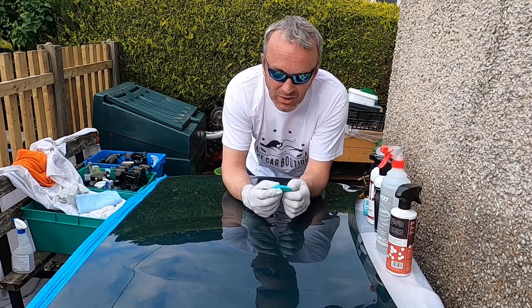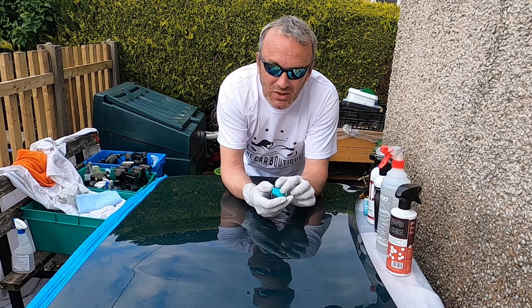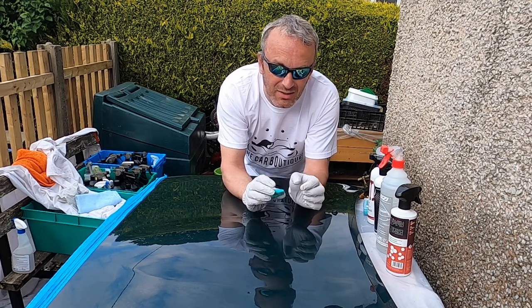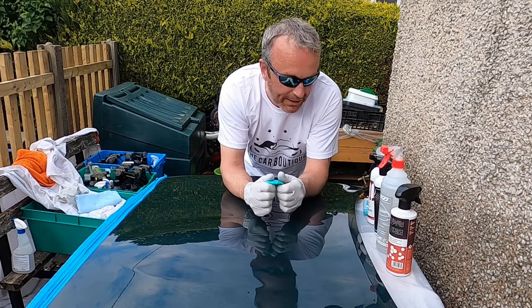The key is that you don't want to be having really dirty clay and then carrying on with the process, because potentially some of that contamination is little bits of iron and various other contaminants, and it's then going to become an abrasive pad, all right? So be quite disciplined with your work with your clay.